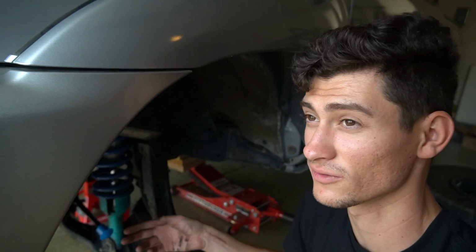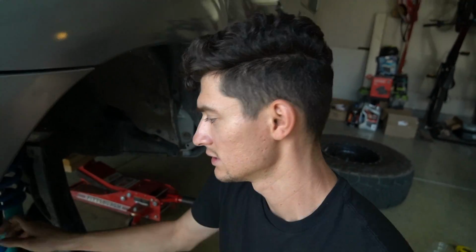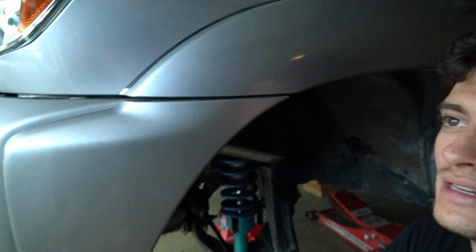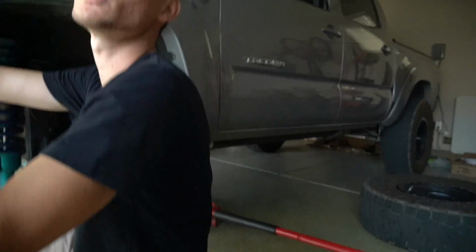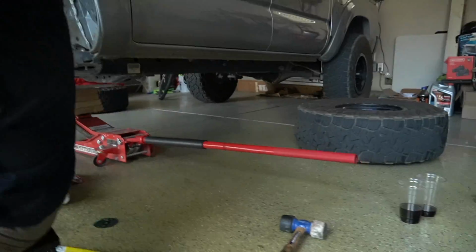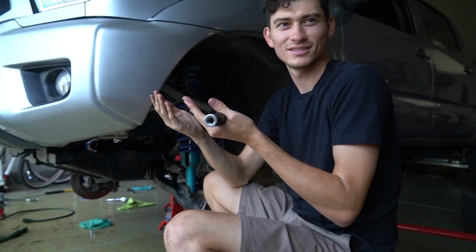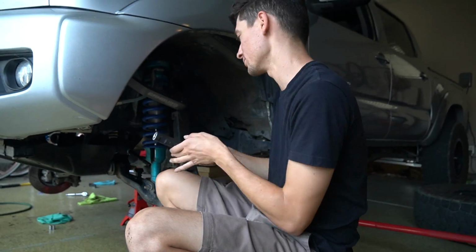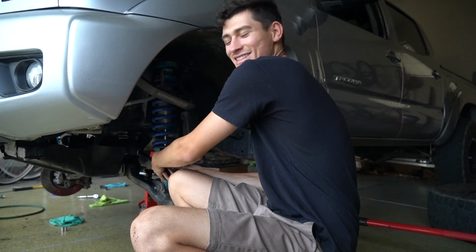But my steering wheel was all messed up when I took it off. The steering wheel was cocked all the way to the left. The toe on the passenger side was kicked out to the right. It was 12 rotations on this side, 8 on the other. So I'm thinking if the steering wheel was turned, do I just go to the middle? Do I say 10? Yeah, it just needs to be good enough to drive down there, not all cockeyed like the last time I did this.